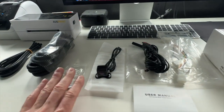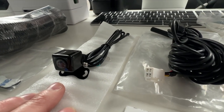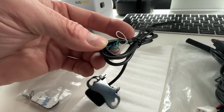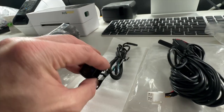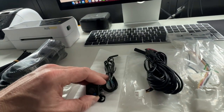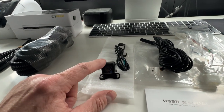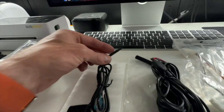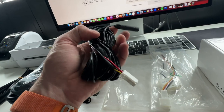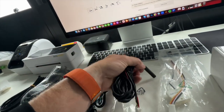This is the camera itself — a small micro HD camera. It has variable options including guidelines, horizontal flip, and vertical flip. You can cut the little loops to change the direction of the image, so if you were using it as a front camera you could do that. You can also turn guidelines on and off. This is a waterproof IP67 dustproof camera and it comes with waterproof connectors as well.